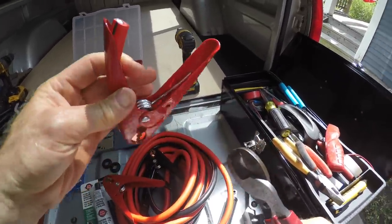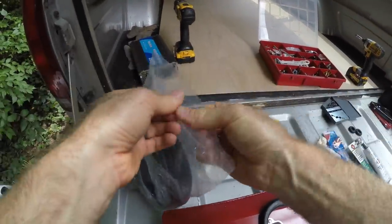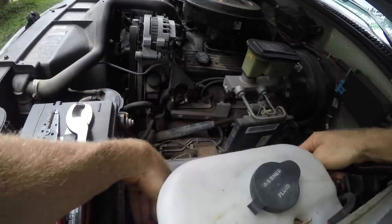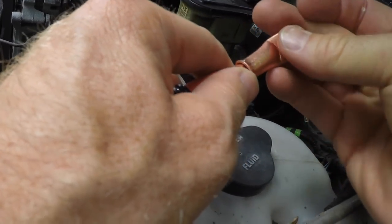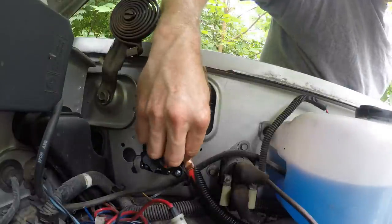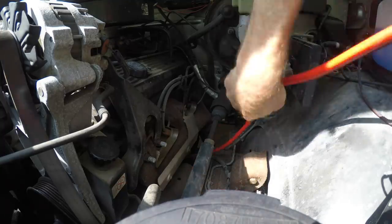I attached the connectors so I could hook up to the battery. I actually used two kinds of conduit on this job: some quarter-inch stuff from Harbor Freight, and also a fatter one-inch conduit from Amazon. The first piece of wire I installed is just a short piece that goes from the battery over to my switched breaker. I don't have a big crimper for crimping automotive wires, so I use my big bench vise and a screwdriver — the screwdriver pressed against the connector makes a nice crimp line. With my wire ready, I connected to the switched breaker and over to the battery, then started running my lines down and out of the engine compartment.